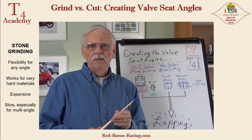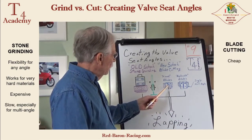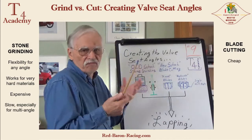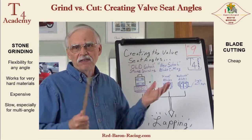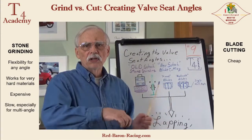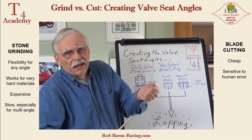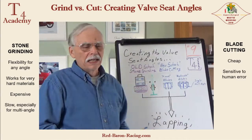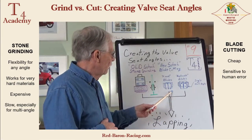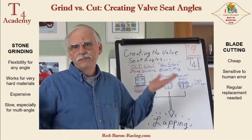The new school way of doing it — the low-cost, Walmart price-point option — is your cutter head with blades, usually tungsten carbide edged. They are fixed blades made into a holder, and there's any number of them, at least three usually, up to five or six blades. It mounts on its own little spindle and you generally turn them by hand. If you can keep the pressure even and not rock it to where you create a tilted disc or an oval, you can get a decent job. The downside is while they start off very inexpensive, as soon as one of those blades gets chipped, you throw the whole thing away and buy another one.